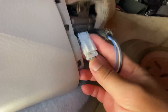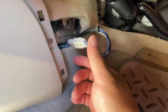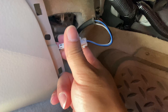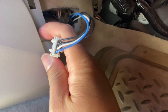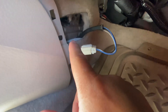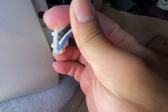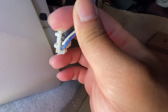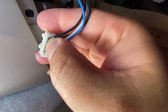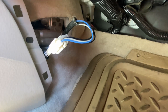Sometimes it could come from the factory just wired up wrong. All you have to do — this connector has a little tab — lift this up and then get a really small flathead, like one of those flatheads you use to take electronics parts apart. Just go in there with the flathead and push up on it, because you can see there are little metal tabs in there. Try not to stab your wires. Get at the bottom of these clips and push it up, and eventually it just comes out — that's how you switch them around.